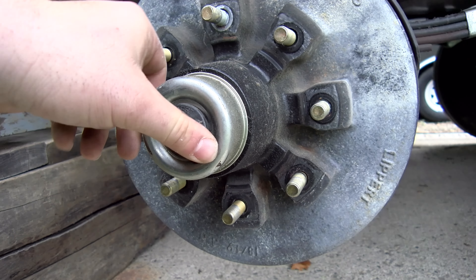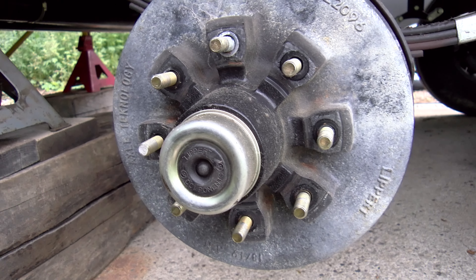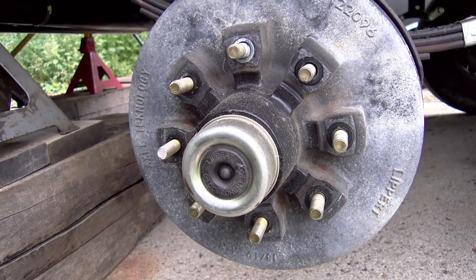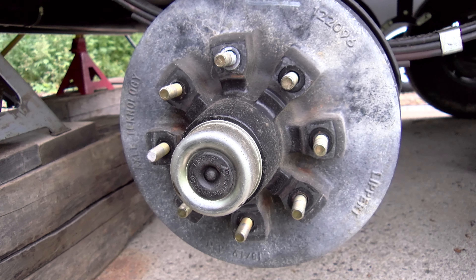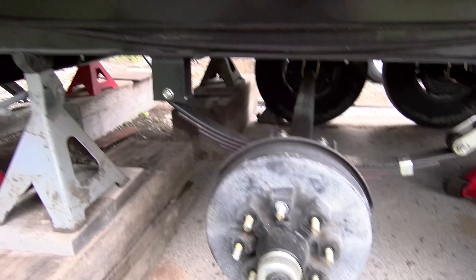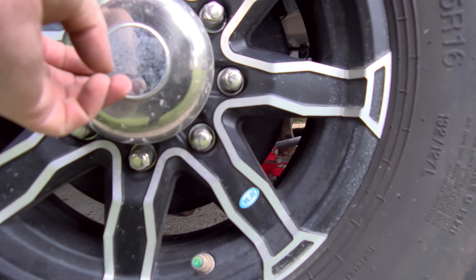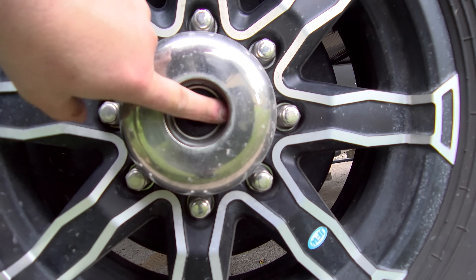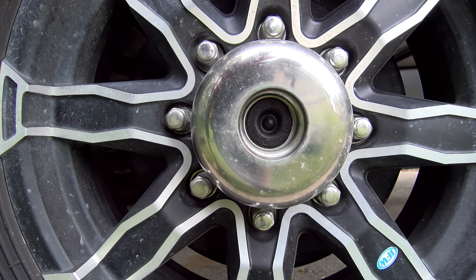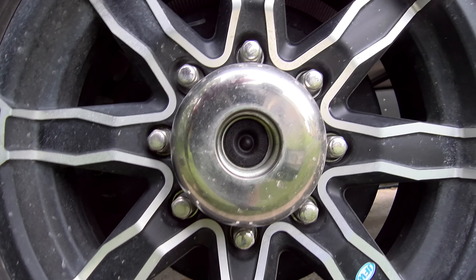Now remember, we're doing the tires. But while we're here, we haven't checked the bearings in two years. So we're going to do the full bearing check, repack them, see if they need to be replaced, and see where we're at. We're just going to continue what we did here for the next four tires and have this completed. I just wanted to show you that if you remove this plastic cap right here, you can come in here and pop this out — it's a pain in the butt. But that's how you can grease them, just so you're aware. Don't over-grease. We'll talk about what kind of grease later on and share that information with you.